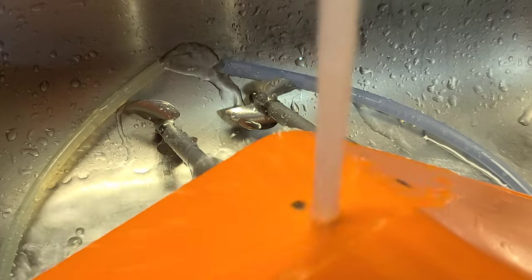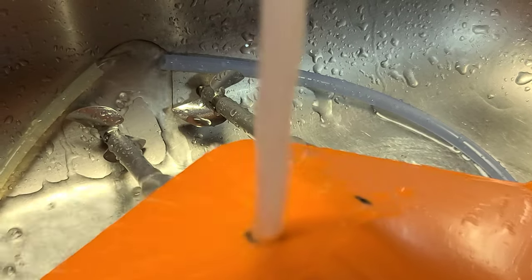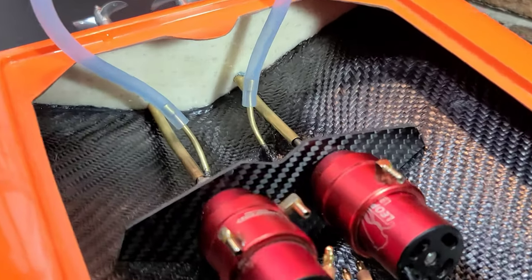You can see the tubes there. We've got flow on that one, and we've got flow on that one - I'm not even right on top of it, I'm in front of it. You can see the flow there - probably won't have any air bubbles when it's in the water. That left one I didn't think would pick up that much water because it looks a little funny on the bottom of the boat, but it looks like it's picking up more water than the other one. That's going to be perfect. Both had a really good flow - one was a little better than the other, so I'll fine-tune that as I build.